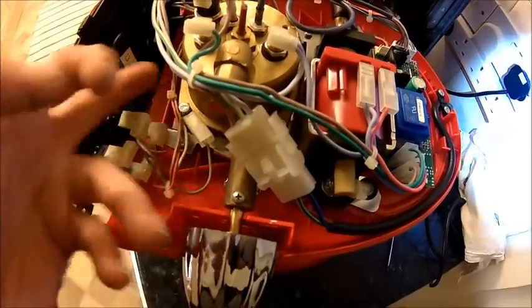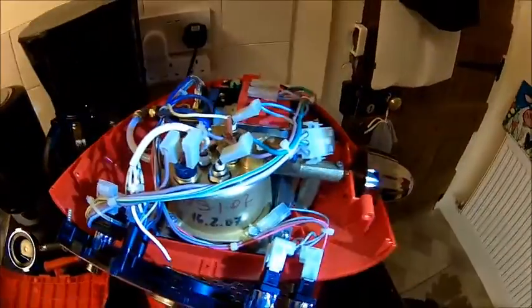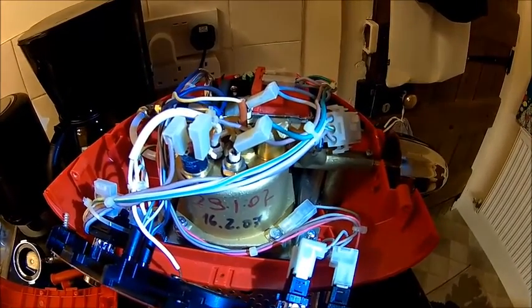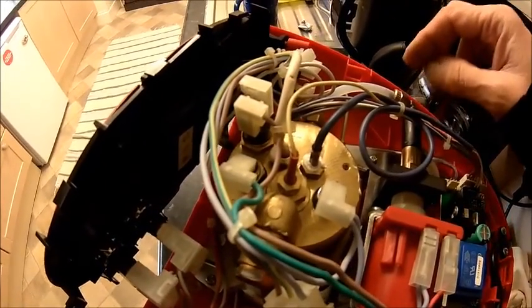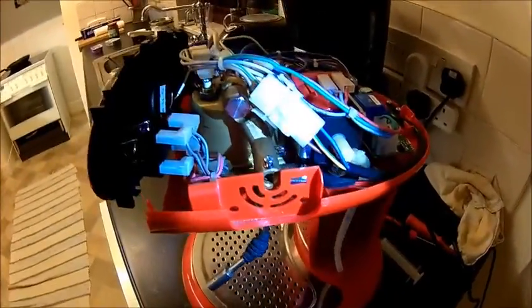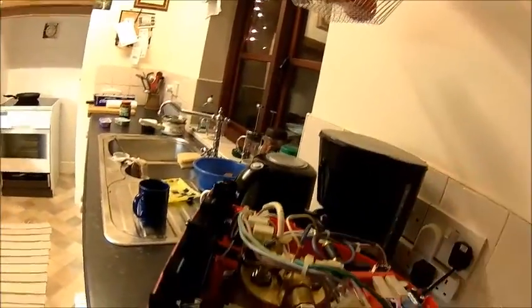If that's not the case, the boiler is completely full of limescale. We also found a birthday which is 16th of February 2007, so it's nine years old. We'll take the pipe off from the boiler and check if that valve goes through, but I think it does. And if that's all free it's either in the boiler or on the outlet here, because the steam valve is completely out, so it should be an open hole and it looks sort of open but you don't really see it because it's going around the corner here.